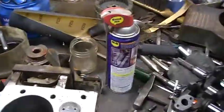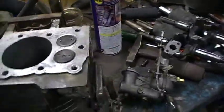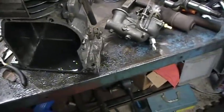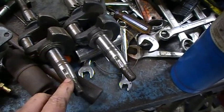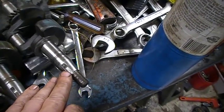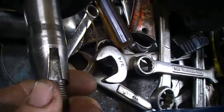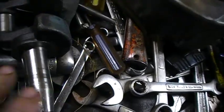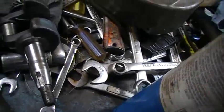I'll have to do a video on some of these. I've got a makeshift David Bradley gas tank here in a bowl and I just hook this hose up to one of the motors - this is where I do all my workshop work. Whatever you do, don't put a steel key in there - get those aluminum ones. Because if you hit something with your tractor, it will damage the crankshaft. I don't know if you could even repair something that's been peeled back like that. This was on a David Bradley Super Power - they really did some damage.